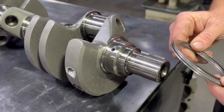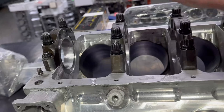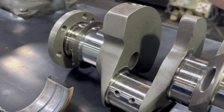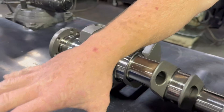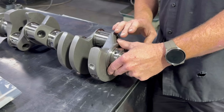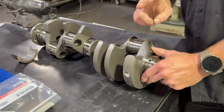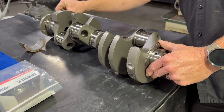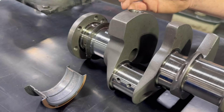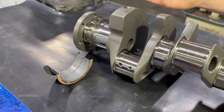The crank in this groove here is going to hold half, and then this piece will be encapsulated in there — we've machined this accordingly. John's crank is torn up; when I set this up the other day it had 23 thousandths of thrust even with a new bearing, which is obviously too much. What we do is run this roller in here and it's going to rely solely off this roller to keep the crank where it needs to be. With the roller bearing and a new thrust bearing, we're going to have two thousandths of thrust — set up a little tighter than typical — and this factory thrust surface will not even be touching.